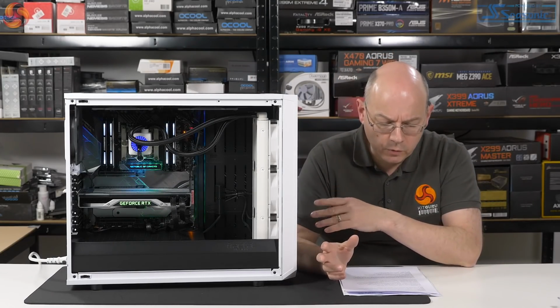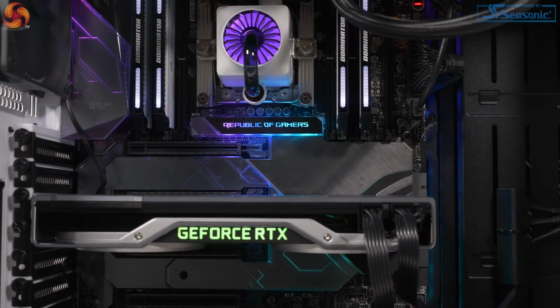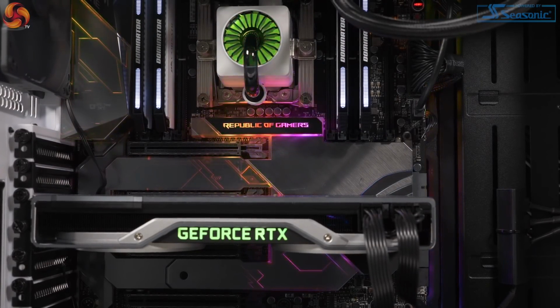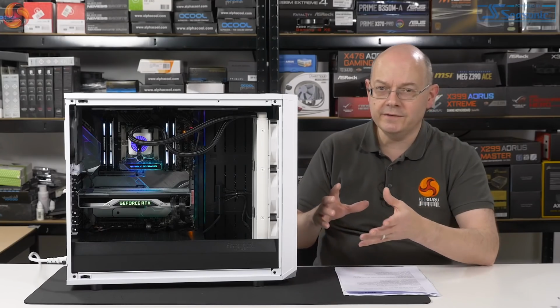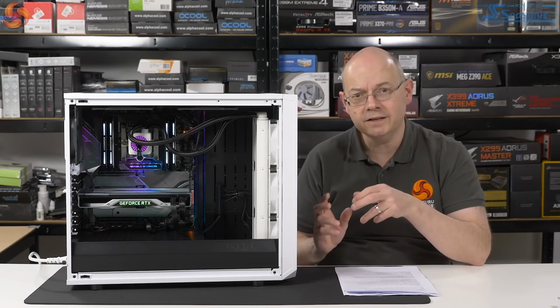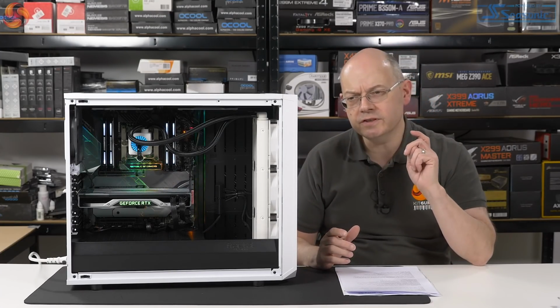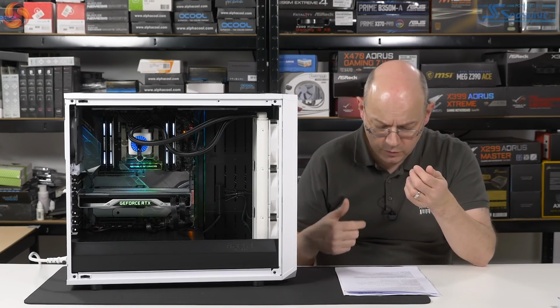Components I've used for this build, they've all been chosen for a reason. So the motherboard is an Asus ROG Rampage 6 Extreme. That's an eATX board, deliberately done just to see how well this case supports eATX, as that's part of the specification. The answer is you have to feed your power supply cables through before you put the board in, because essentially the board covers the grommets. No surprise, if it was any other way you'd have a very big case with the grommets to the outboard, and with an eATX that would look peculiar in its own way. We've seen this a number of times. So this is nominally eATX, however my view is you're better sticking to ATX.